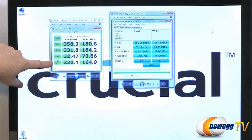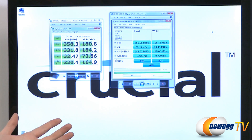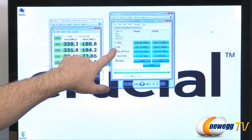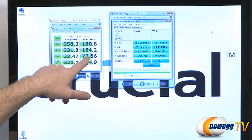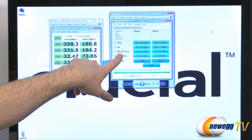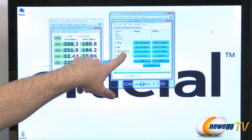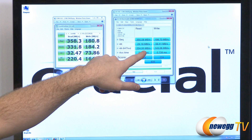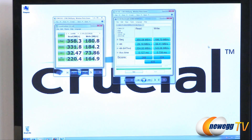Good numbers there. Then finally our QD32 numbers — this is really only applicable if you're running an enterprise solution such as a server; you're not going to do any QD32 stuff with a normal operating system. But it is a really good test for an SSD because oftentimes it's the only way you can really stress an SSD out by putting up a really high queue depth like that. Moving over to our ASSSD benchmarks, we have essentially a lot of the same data. Sequential reads and writes are pretty much on par with our CrystalDiskMark numbers. For 4K 64-thread — this is essentially another 4K random test; however, it threads 64 of them at the same time, which is very similar to what a 64-bit operating system might do, so you see significantly more throughput.